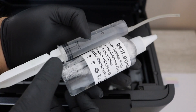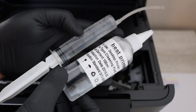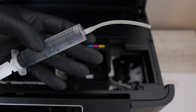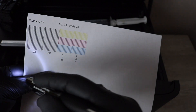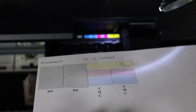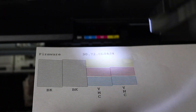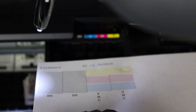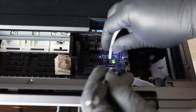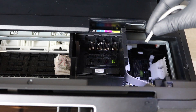At this point you are going to be using the Best Printers Cleaning Kit. You are going to have a 20 milliliter syringe — fill it up all the way to the brim. If you haven't gotten yours, link in the description below. You can get it within a day or two with Prime. Have your nozzle report laying out in front of you. There's a pattern on the printhead that follows the pattern on this report, so you're trying to look at what is the worst color, and that is what you're going to work on first. Grab your syringe and put it over the color that, in your opinion, is the worst.